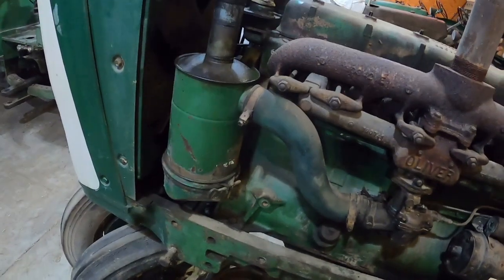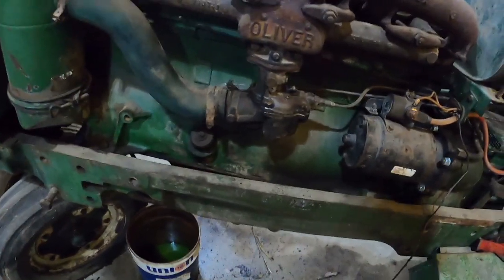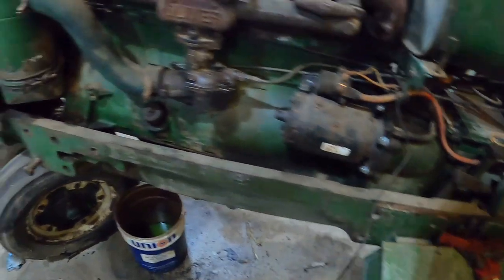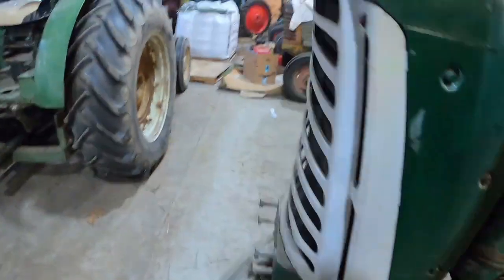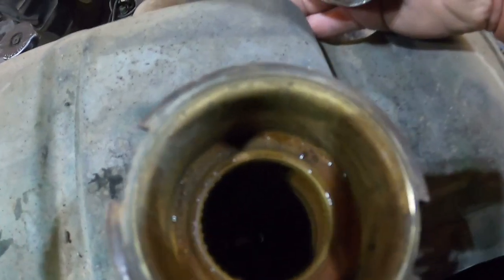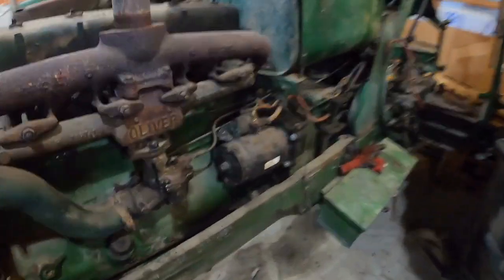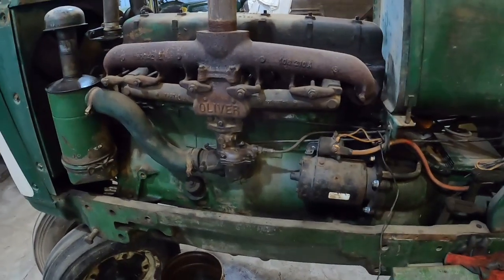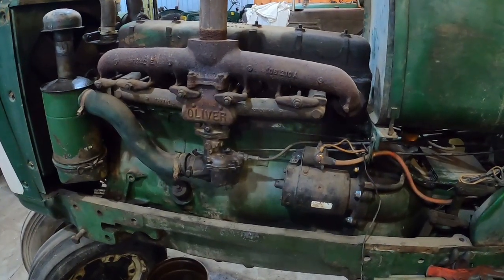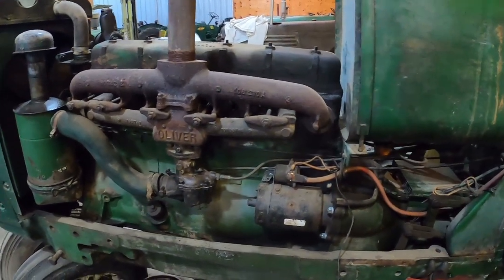And looks like the water pump stopped leaking. That means it's either out of water or there was just a piece of crud in there on the seal that worked its way out. And let's just climb up there. I still see water over the top of the core. Cool. Sometimes a guy gets lucky. So we'll start tearing down and see if we can't swap this manifold and try it out.